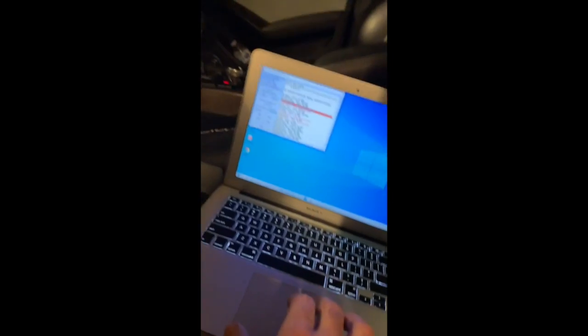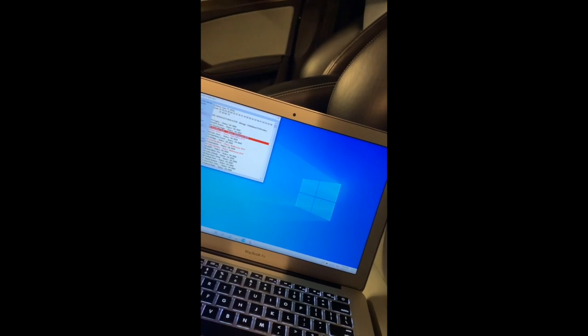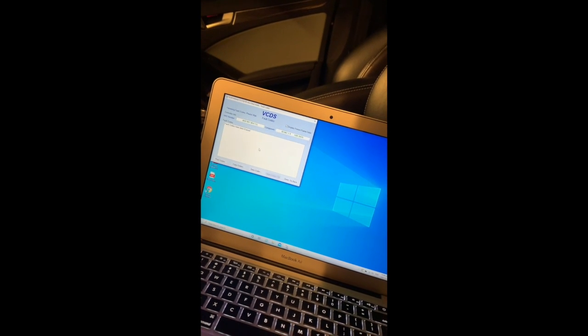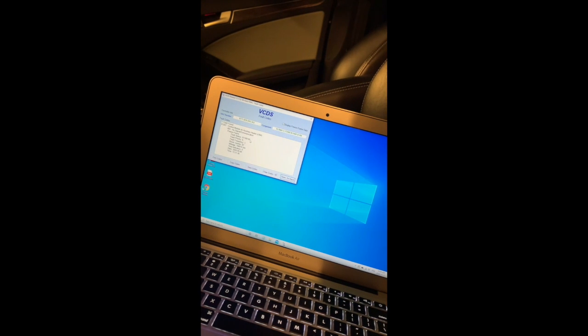All right, so the scan has been completed. Let's have a look before we start everything. I recharged the battery overnight. Got the VCDS scanner, which makes it a lot easier. Best investment. That's just a door handle on the right front. I know that its sensor has to be replaced. It's a bit pricey, I'll do that later. As soon as I clear the code it goes away, but when I start the car and turn it back off, the code will come back, and the door handle sensors won't work to touch.